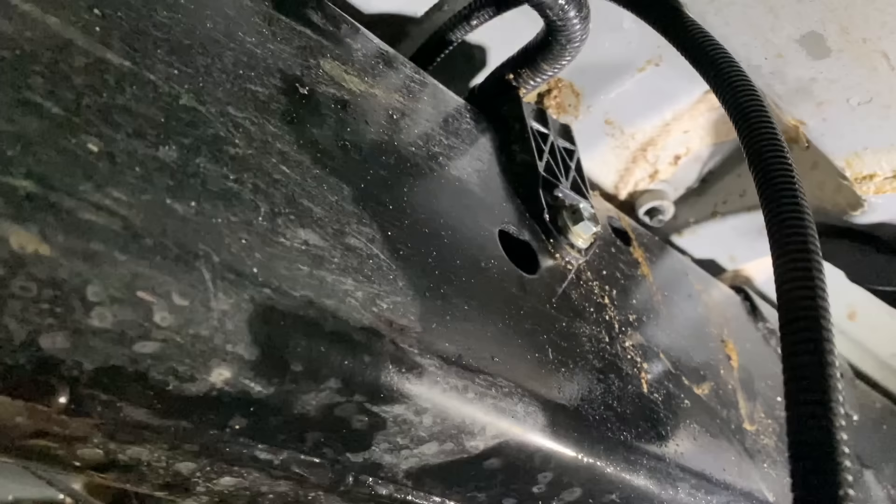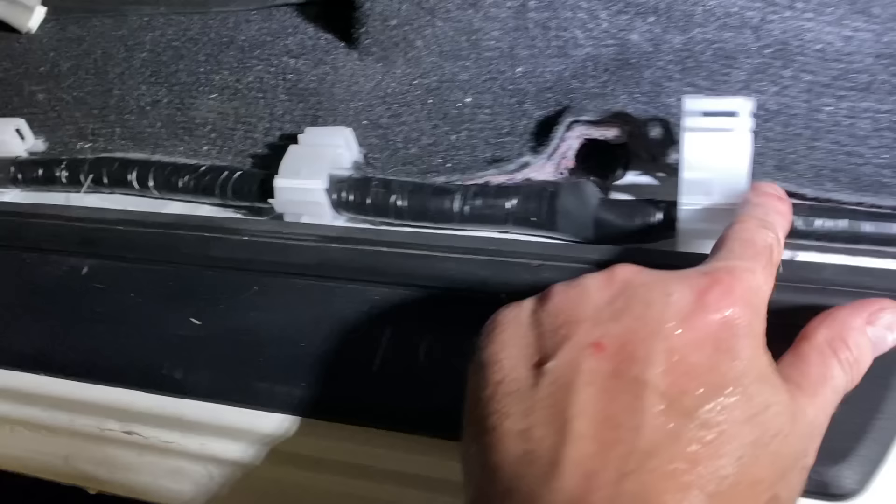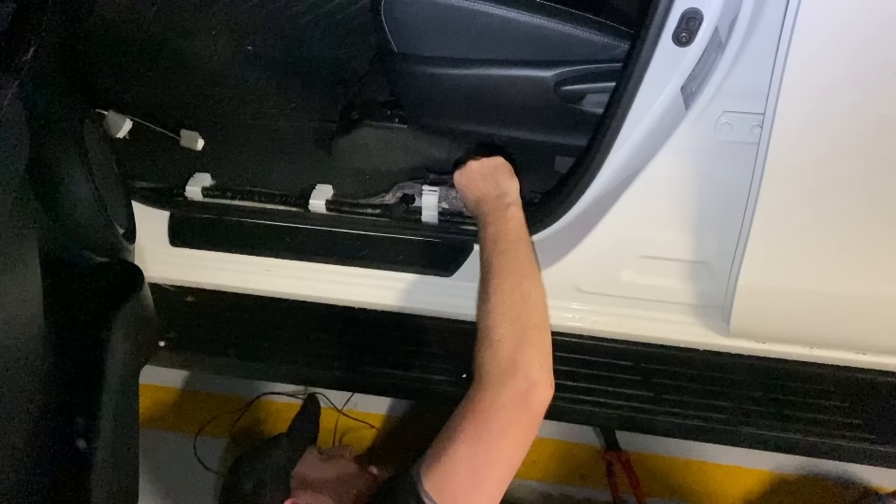You can see the cable run coming up under the vehicle to a little rubber grommet just there. Pull the grommet out and put a small snip in the center of it with some pliers, then feed the camera cable plug straight up through that into the footwell. When it pushes through, the conduit and rubber will seal around it nicely so you won't get any water into your footwell. Then come up and run it along here with all the factory looms to the kick panel plug.